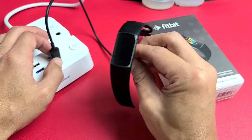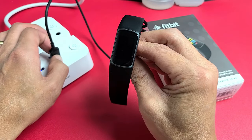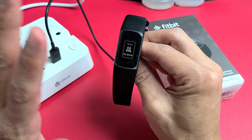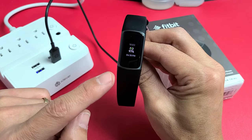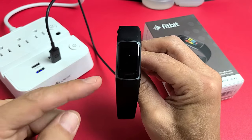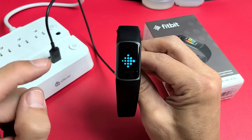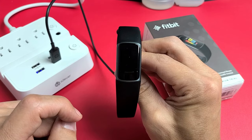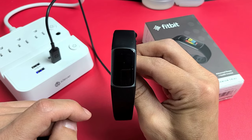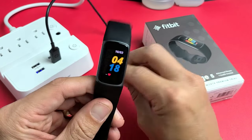We'll do it together. Here's the button. Press it: one, two, three. Now just wait patiently — every time I click, I can feel it vibrate. It's going to go ahead and reboot. It just vibrated, and now we should see a Fitbit logo. When it boots back up, we should see a battery indicator. And there — you can see that battery indicator now.